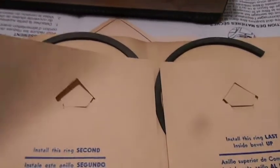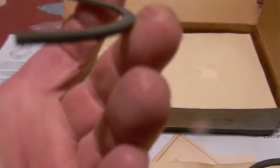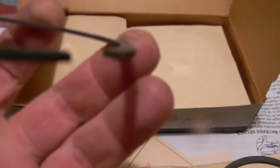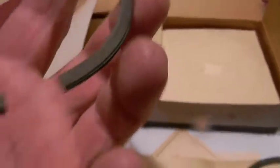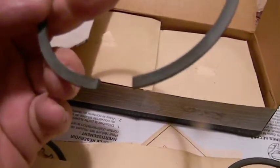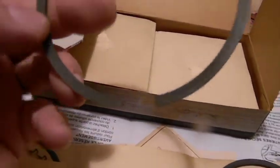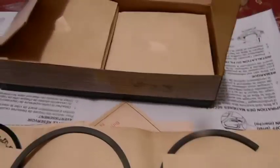These are the rings that will be going into the 360. You can see it's not a square cut ring. There you go — I can see that little notch. Usually they'll put a dot or a letter or something to tell you what's the upper side, which these do not. But it does have the groove on it, so that's where you go.